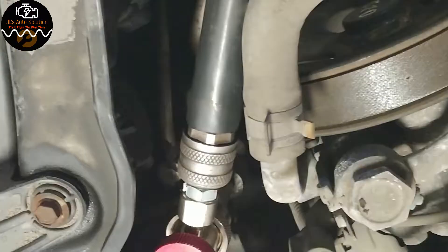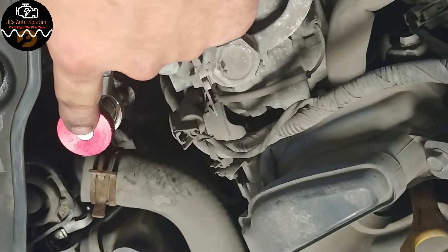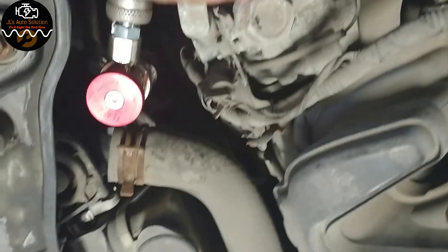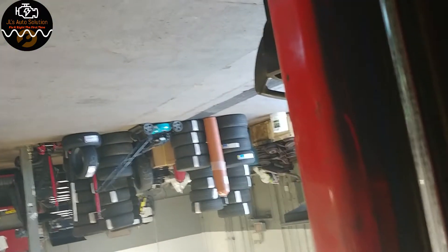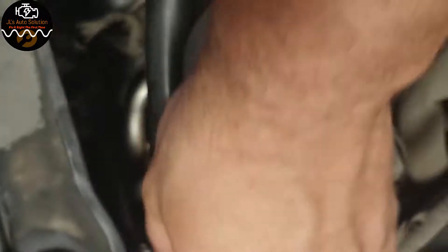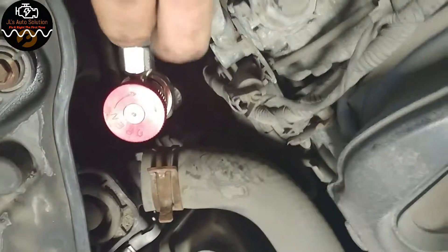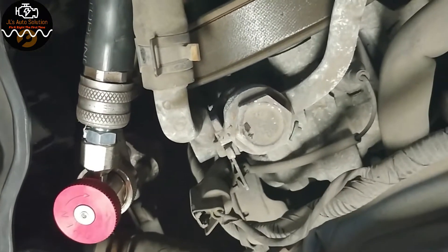In order to locate this fault, I retrofitted an AC adapter and AC high pressure adapter to my regular air hose. We ordered a tank but haven't been able to install the gauges onto it yet, so this is just another way for you guys to find an AC leak on your vehicle without needing nitrogen systems. One of these valves is about 45 bucks — add a hose fitting onto it and you're good to go. Make sure it's well sealed because if not it's going to leak.